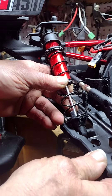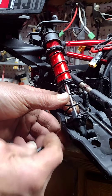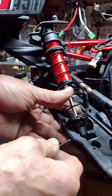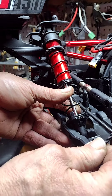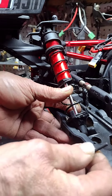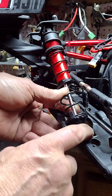What you need to do is have this either directly even so you can just put the pin right back into the shaft, or I prefer just a little bit of pressure down and then putting it in. You just never want to lift it up to put the pin in — if you're lifting it up, you're just wasting your grub screws and you're going to wear out a piston. You have to have it just nice and tight or above it and then set your pin in there.